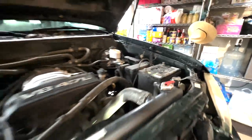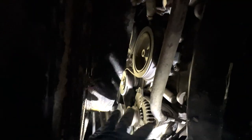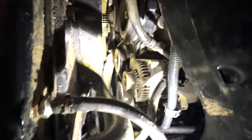Disconnect your battery before doing your alternator — rookie mistake. I got too excited about wrenching. This is a pretty self-explanatory alternator though: three bolts up front, one hidden behind the power steering pulley. You want to undo your tensioner first, then undo all your plugs and bolts. There's one here, one on the other side. Almost 80-90% of the way there — just need to take off the last bolt. I'll switch to time-lapse mode.